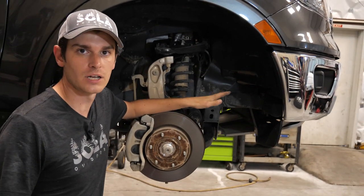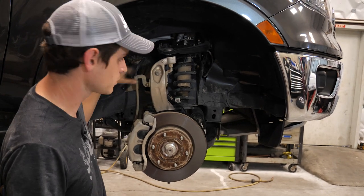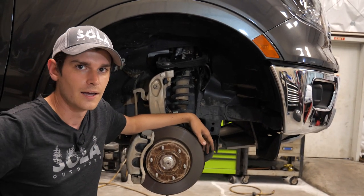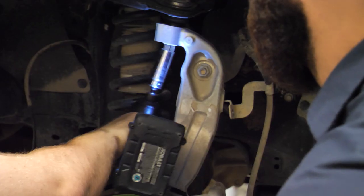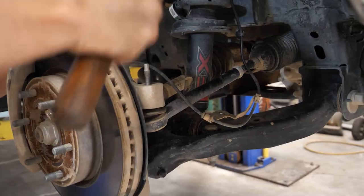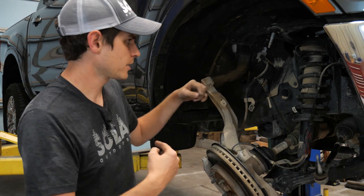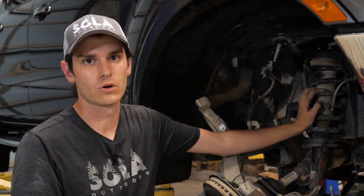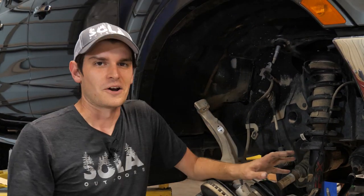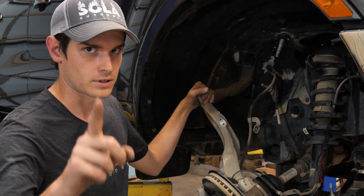The tires are off the truck, now it's time to get into the front lift. Pretty straightforward — just have to disconnect the upper control arm, a couple of odds and ends. The sway bar has got to come off; you need to disconnect it at the end link or at the bracket to the frame. Dylan is going to knock out the spacers on the back. The hardest part is getting the strut assembly out, and the easiest way is to just bounce on the lower control arm and it'll work itself out — just be careful not to put too much bounce on the CV because you can mess them up significantly. We also busted the end link on the sway bar because we were confident we could get it out without disconnecting it and we were wrong, so disconnect everything and don't risk it.